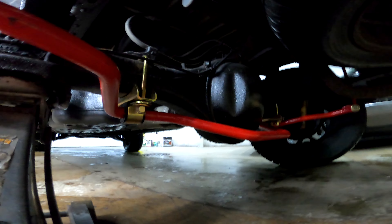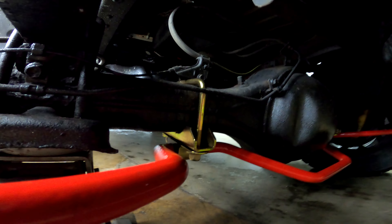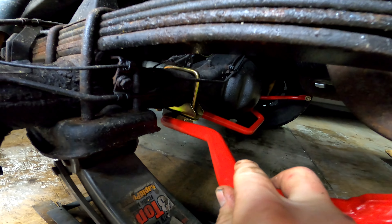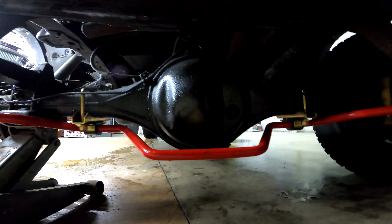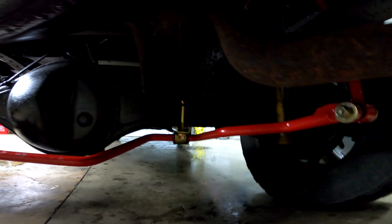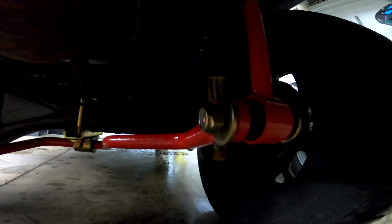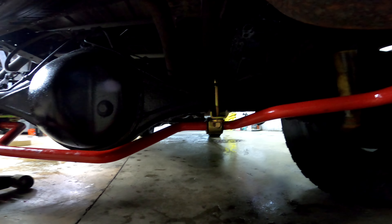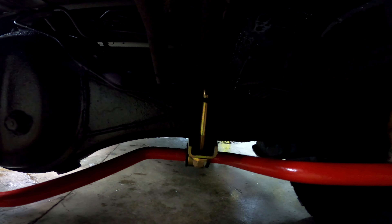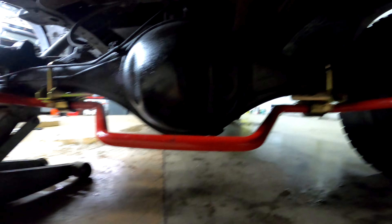Just kind of work your way around. You're going to have to use a jack probably to lift up the bar so you can secure the U-bolts on each side. This side is on the outside of that brake bracket, and the passenger side is on the inside. Just hand tighten everything and let it sit loose in there. The nuts — the pictures say to put the nuts on the inside, just the same orientation as the top bolts. Here you'll see where it rests — the U-bolt on the inside of the brake line bracket. The bar should be centered with the diff, just like that. Then tighten everything down.